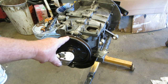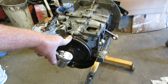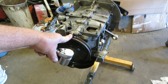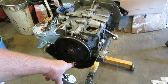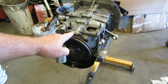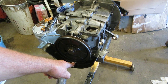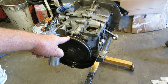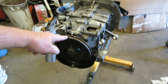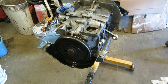See, this is being TDC, top dead center, or maybe not, depending on the cylinder. Of course you've got TDC, which is firing, and then you've got squash, bang, squash, suck, bang, blow. So it's squashed, it's firing right now, it's pulling down, so that's your power stroke. It's coming back up again, and that's your exhaust stroke, coming back down again, and that's your intake stroke, coming around again, and that's your firing, or your power or your ignition stroke.